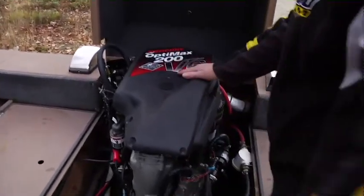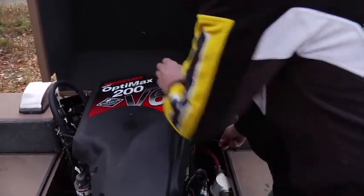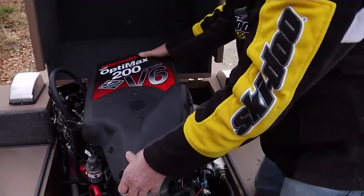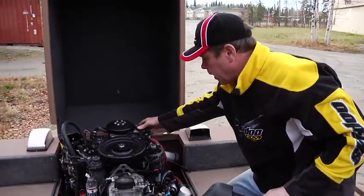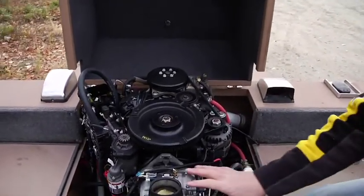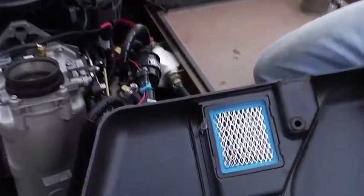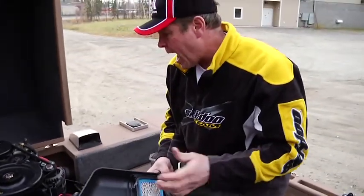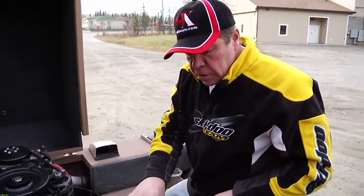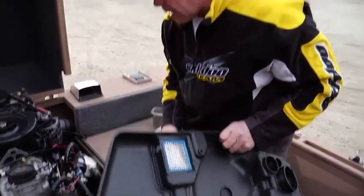This is your engine lid — it's very seldom you'd need to get under it, but there is a bungee cord on the port side. Just disconnect it, wiggle the lid straight up, and it exposes the flywheel, alternator, and air handler system. There are no carburetors since it's a direct injected engine. There is a filter under here that feeds the air handler and compressor. If you take it off and it's all black, that indicates a blown hose or similar issue. They recommend you change these filters annually — it's an inexpensive filter.